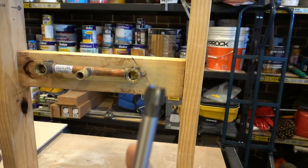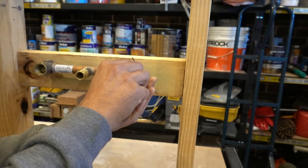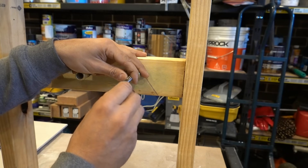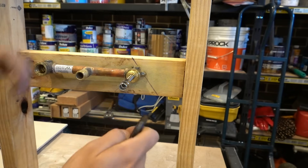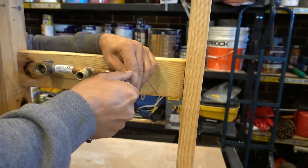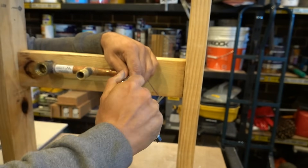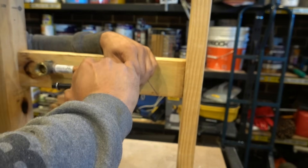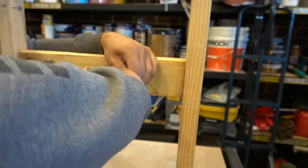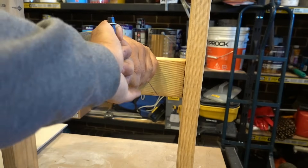The first thing we're going to do is tap some new threads for our new seats. Use the locking nut to hold everything in position — drop that in and screw it on. Just like the resurfacing tool, that makes sure everything's nice and straight. Put the socket set straight over the top, take the allen key, get a good hold of everything and start tapping in those new threads. You can hear that grinding action — try to keep it as straight as possible. The hardest part is just starting it off; once it starts, it'll simply drive itself through continuously.